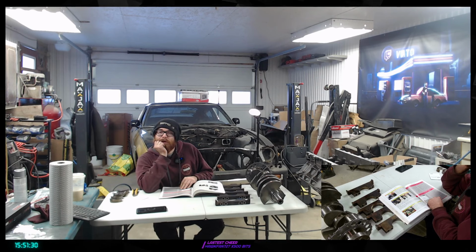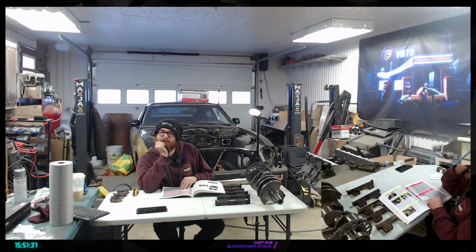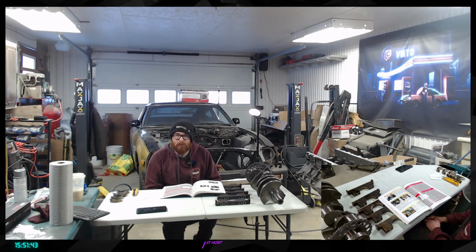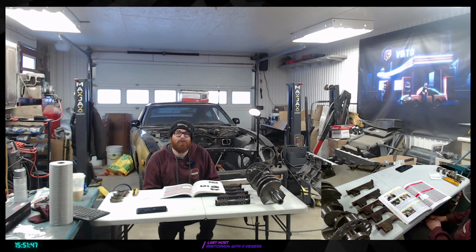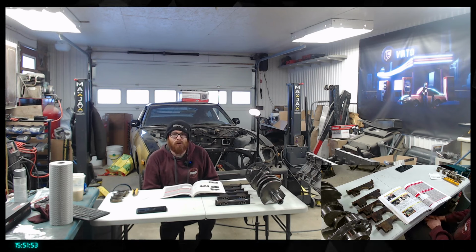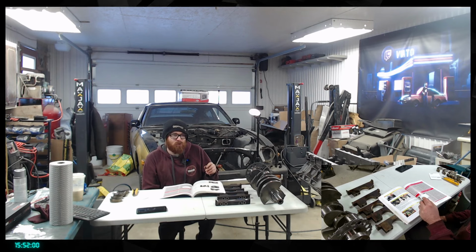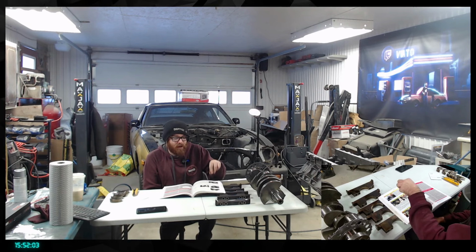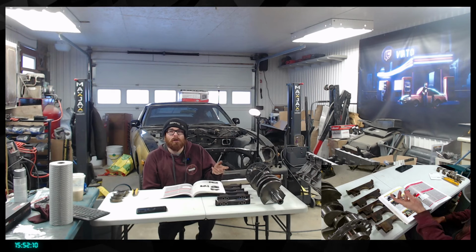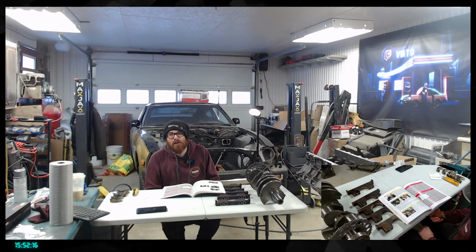While we are talking about horsepower, will methanol injection provide benefit or is it really only for fueling the turbo? I know people use a mist nozzle to spray it into their turbo inlet. It will be adding power for sure, but the car is already going to have way too much power. Methanol injection is also a really good way to cool down the cylinder from the combustion itself. The mix of air and methanol brings colder air and colder combustion into the cylinder, which results in more power output, but also a cooler explosion, which helps keep down the temperature. However, like I said, it's a bit crazy.